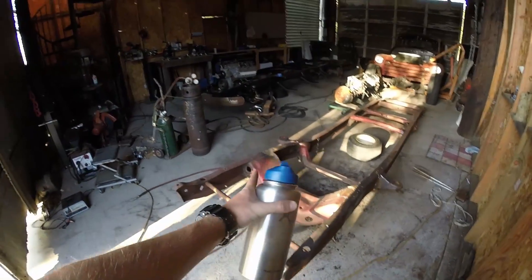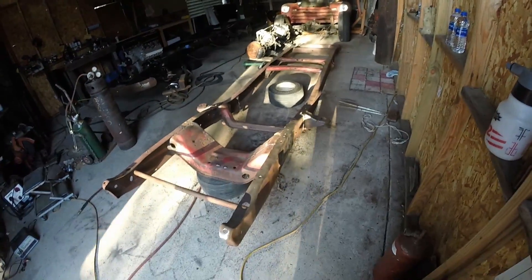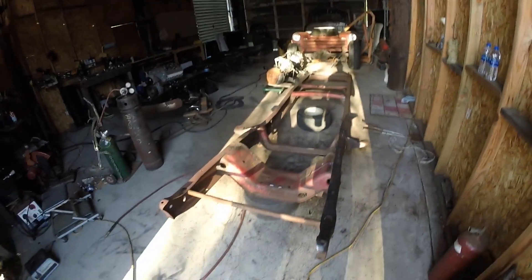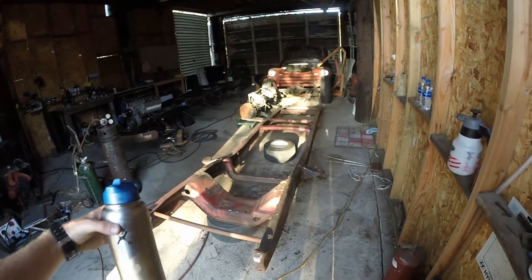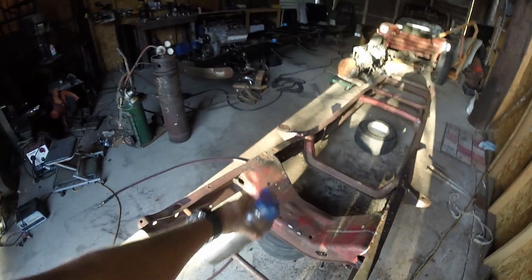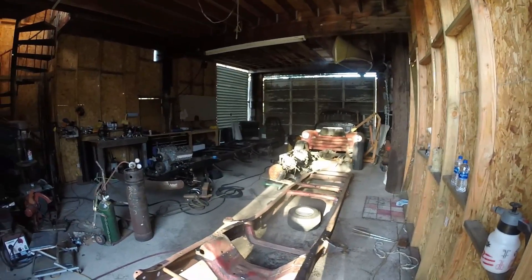Alright, so this is where we're stopping. Like I said, we ran out of gas, so we'll probably get that filled up and then cut the crossmember out and mock the front end up. Not too bad — got the coil bucket off, front end's kind of clean, got this tube in. We'll finish it up on Thursday and get this center junk cut out. We're going to torch it from the center and then hand-cut everything inside the C-channel on the frame, then mock up the Crown Vic. Like the video if you enjoyed — I'll see you guys in the next video, thanks for watching.